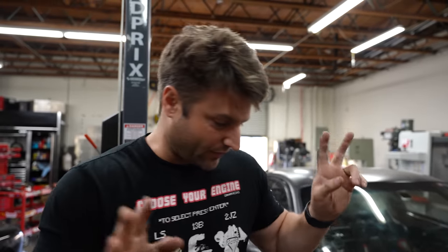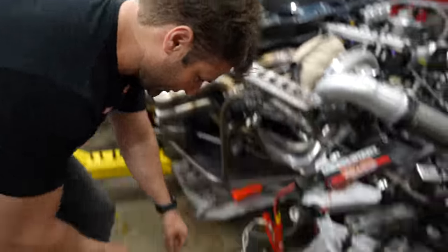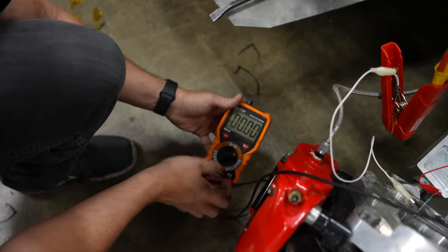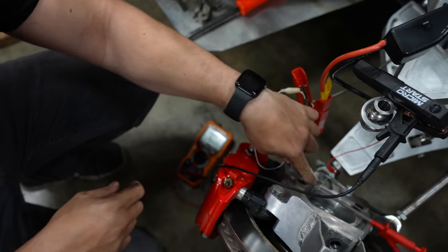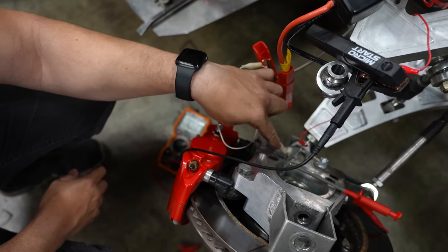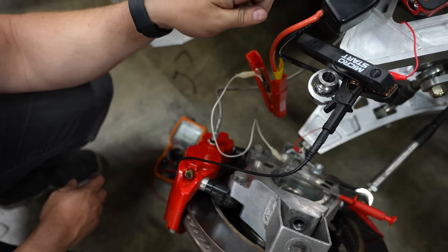I did it, it didn't work for a little while, and then check this out. So watch my multimeter here. We're going to go ahead and set it to voltage. Remember, voltage is not on off. I'm measuring the output. It's going to ground through a 200 ohm resistor, and then this is simply powered through the positive side of this.